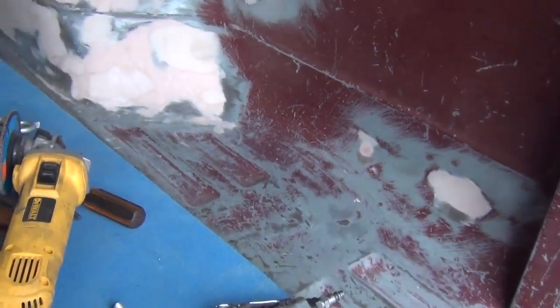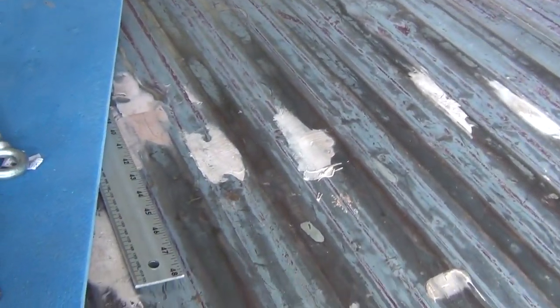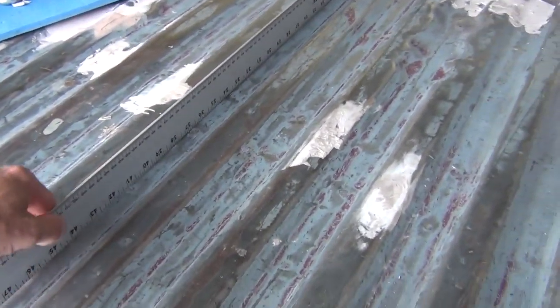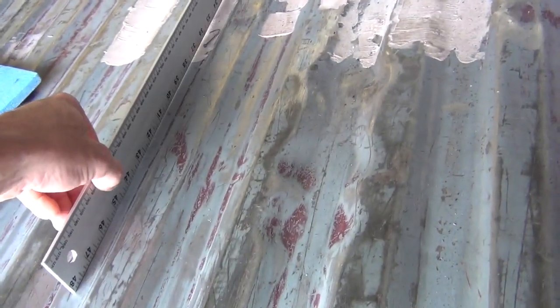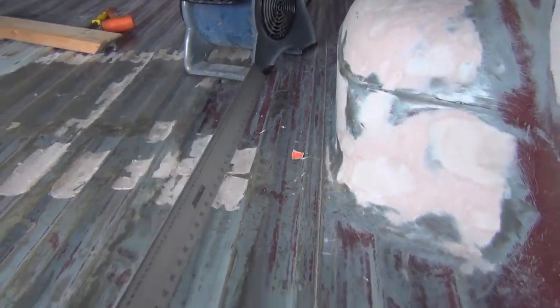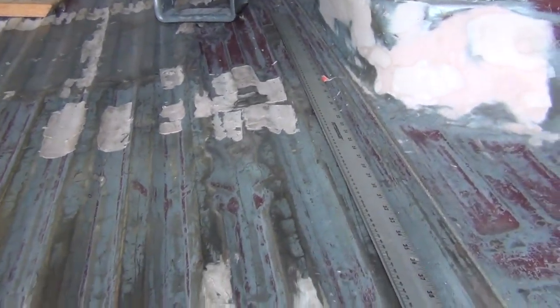But what I found out, to get this out of the way, is once I got all the middle bolts in and bolted down tight, this bed is not as badly warped as I thought it was. Remember how I said it was warped really bad? That there I'm going to fill in, where I welded in that panel, and it's low. But it made it not so bad. As I pulled the bolts down, it pulled the bed down a lot flatter than it was. Not perfect, but it's going to be less work.